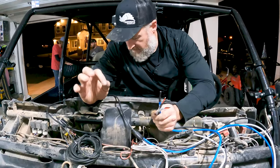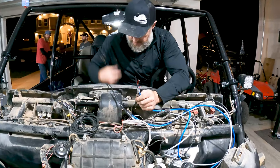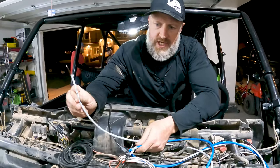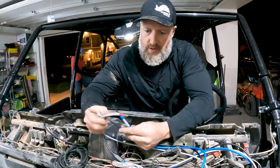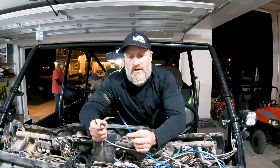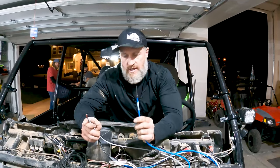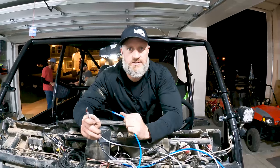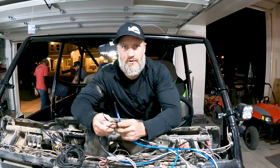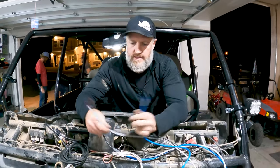So we got the cable run from the sensor up through, connected to the back of the display. And now we're just wiring up the switch and the power. White switch cable labeled really nice for you — power. And this one's really cool — this is a fan cable. What Razorback has told me is they're actually coming out with a CVT belt fan, and you can connect this to it. Once this temp gauge reads a certain temperature, it'll kick the fan on for you, which I think is super slick. I'm kind of looking forward to that, hoping I can do that once they come out with it. So we'll just tuck this one away and make the final connections.